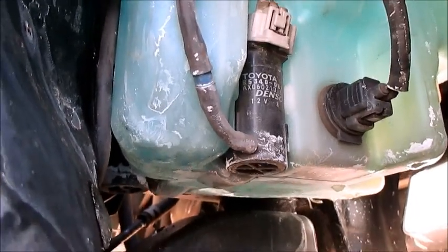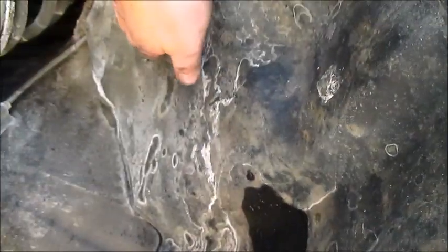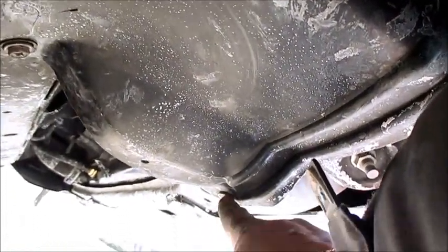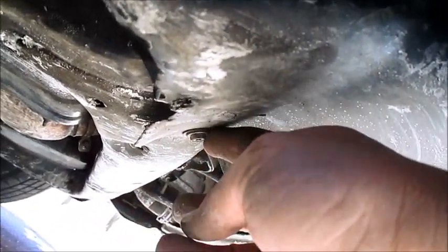Just thawed it off and then they worked fine. If you need to undo this one right down here, here's another screw. If you need to replace them, obviously you'll need a little more room. The front bumper can bend back a little bit — there's a screw underneath here. The rest of the wheel well cover has a quick fastener here, a bunch of other fasteners, and two more down here. There's also a fastener here which is actually a bolt, so make sure you keep track of it and what screws go where, because there are a few differences.